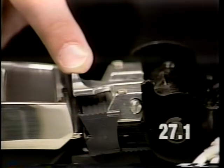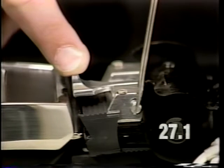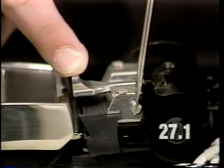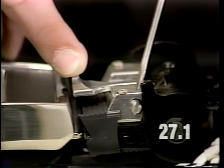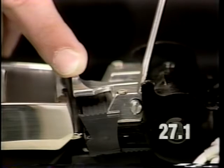If the tilt latch lever is broken, replace as follows. Unscrew the tilt latch shaft from both ends and slide the shaft apart. Pick out the broken part, install a new lever, and screw the shaft back together. It will be necessary to hold the handle fork all the way down when repairing the lever.